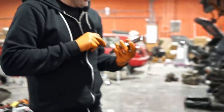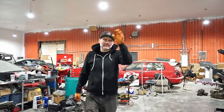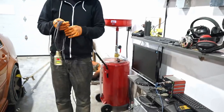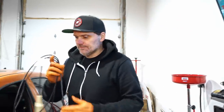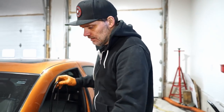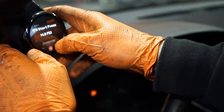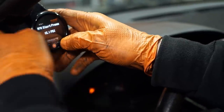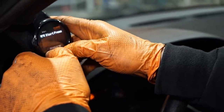Yeah, they're not good. All right, tach signal hooked up, ground hooked up. Time to go. Laptop's on, or not laptop, dyno's on. Confusing. Time to get the old pendant in the car, hook up the laptop, and see if they got this boost controller hooked up right. So I'm just going through the boost controller and setting a few things up before we do anything. Although the boost controller is turned off now, I plan on turning it on momentarily. I'm just going back through and making sure the fail safes that are built into the controller are set up in here.